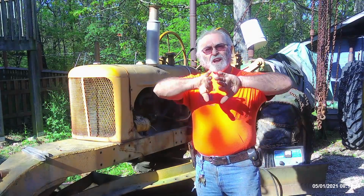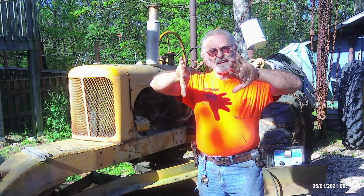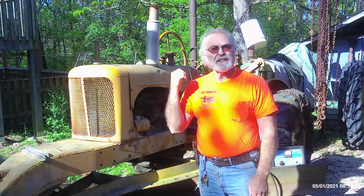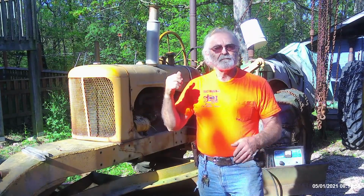What happened is, whatever's in that fuel, the age of that material, and the improper use of it that I apparently did caused the liner to totally slide all the way down and turn into a gummy residue about a quarter of an inch thick on the bottom of that gas tank. So I'm going to have to fight with getting that gum out of there and totally cleaning it, and then properly installing a different type of fuel tank sealer. So I thought I'd clarify that.